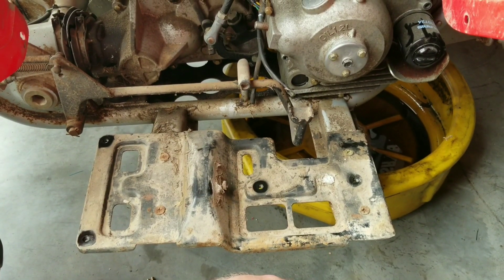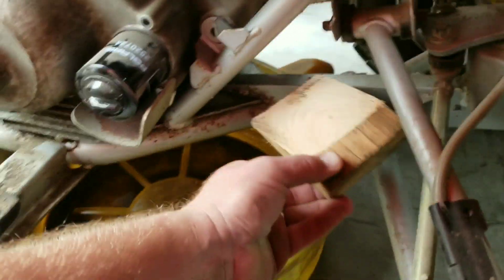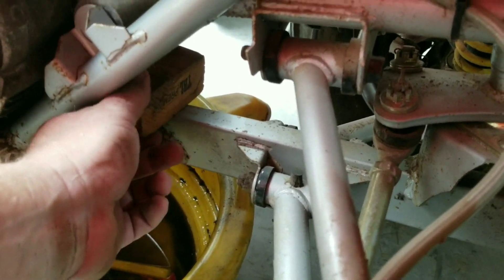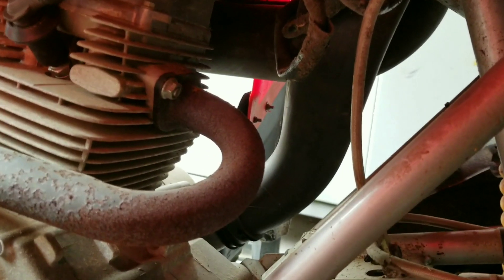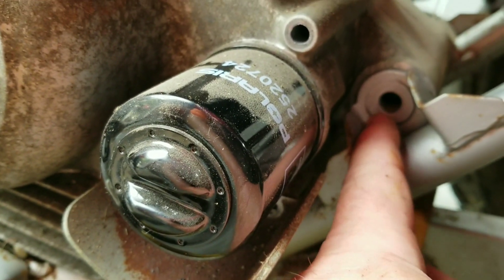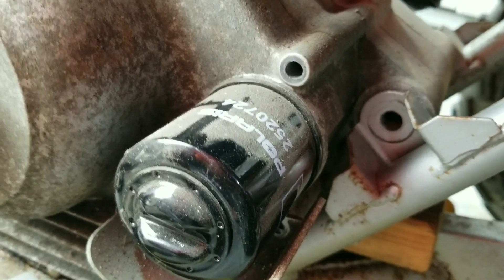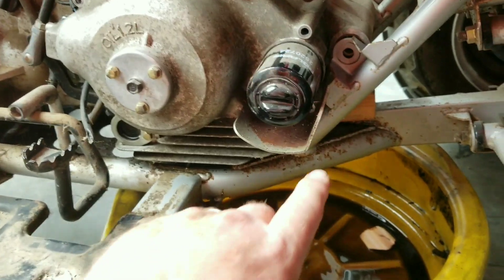You're going to have to cut a taper in a really short section of two-by-four. Now that we've got the bolt out, we're going to hammer that under there. There are some fins under there that you do have to be careful of, so do this at your own risk - just gently tap that under there. We don't have to lift it much. When I hammer that in, that'll lift the motor a little bit. We've only got to go about a quarter inch to get those bottom case bolts out. You can see it lifted it about that much.